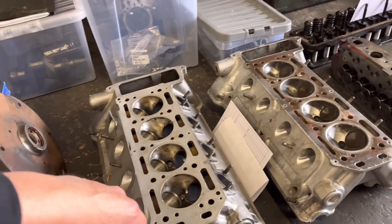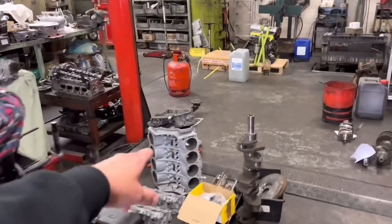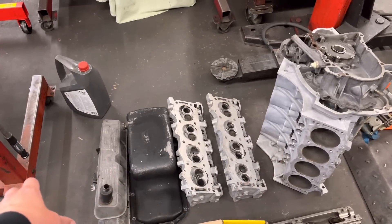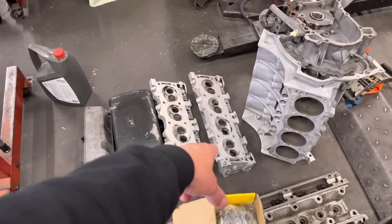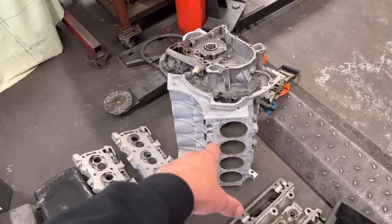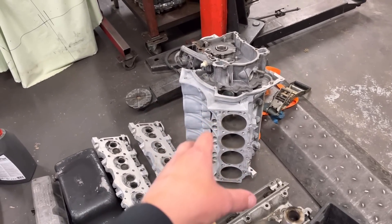They're going to replace it with this cylinder head so we've got to take quite a bit off the surface of the head and we've got to replicate the seats for this one. As you can see they've done the porting already, we've just got to replicate the seats for the bigger valves. So unfortunately all that work seems to have been a bit wasted and we've got to replicate it on this head. Then I'm going to set the V8 up - this is for Devon 4x4. They're going to do the building of this engine. It was in a hell of a state when it came in. All we've done is thoroughly cleaned it with our pressure washer and scrubbed it - it took quite a few hours, it was in a right old pickle. We're going to soda blast the cylinder heads and do the valve seats and reface those. The block is going to go out to plus 20 and rather than bore them I think I'm going to do them on the hone over there on the Delapina, running the coarse stones down there to rough them out first.